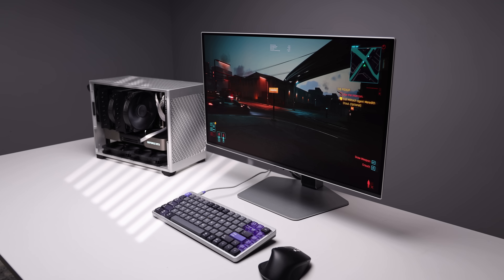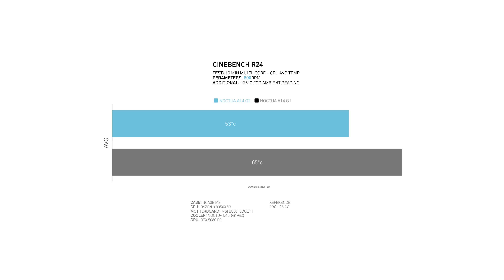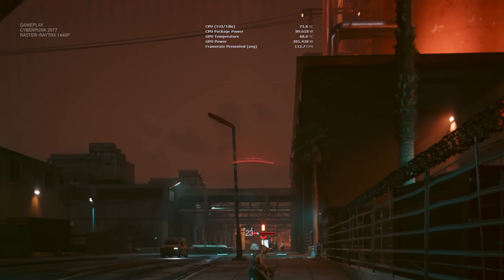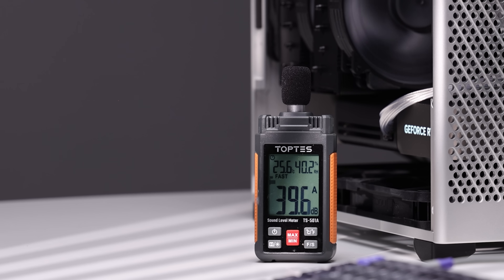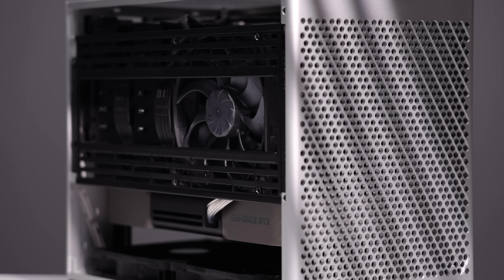Performance was what you'd expect. The D15 G2 Chromax is extremely quiet — at 800 RPM, the bottom fans are barely on at 500 RPM. In Cinebench R24 at 800 RPM, the 9950X3D scores 53 degrees above ambient, or 78 degrees straight — a large 12-degree improvement over the previous generation. After 30 minutes of gameplay at 1440p and 4K in Cyberpunk 2077 with ray tracing, the 9950X3D and 5080 are seated in the high 70s and low 60s. Those G2 Chromax fans are so quiet you can run up to 1,000 RPM and still have a comfortable session. With the 5080's fans locked to 1,200 RPM, noise levels just break 40 decibels from a noise floor of 34 decibels. The side intake fan brings it up to about 42-43 decibels.